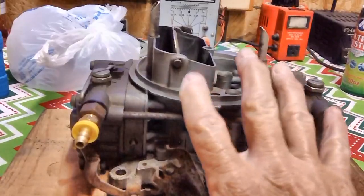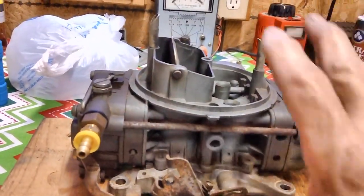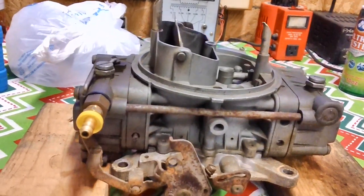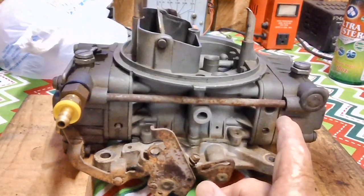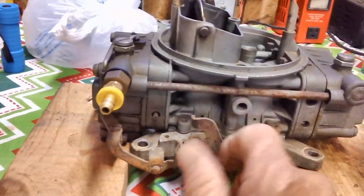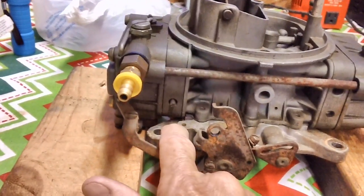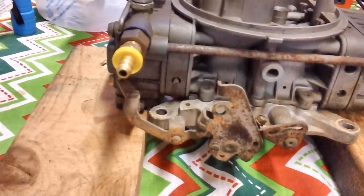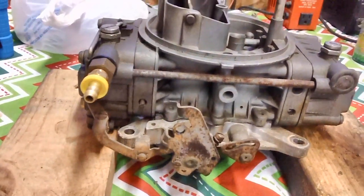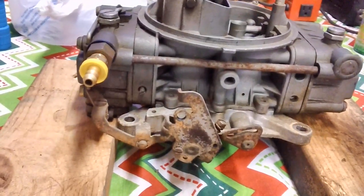You'll get someone who says, I'm going to change this carburetor, and they don't even think about what it's going to entail. So they put it on the car, and they go, oh man, none of this linkage matches up. Well, let me see, what can I do? I guess if I just eliminate this part of the old stuff and just hook this up, I can get it to work. This dash pot was missing because the old carburetor wouldn't fit on this one here. So they got rid of that too. So we wound up with just that one throttle rod. That was it to run the entire carburetor, and you can't do that.